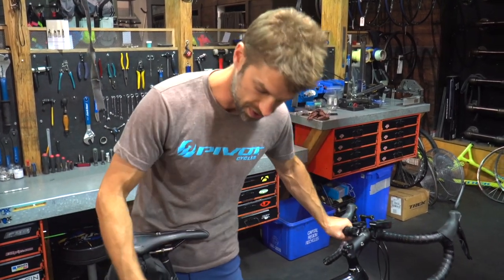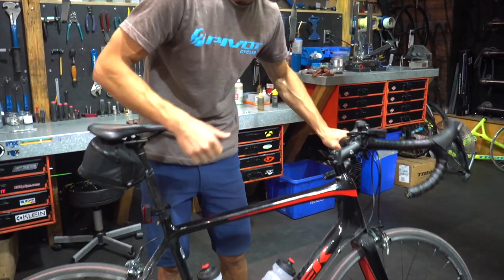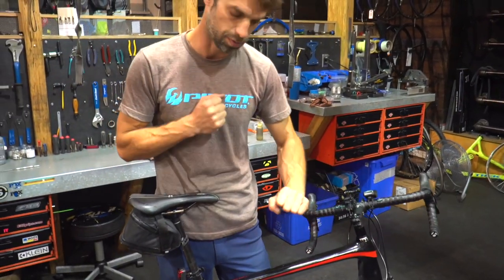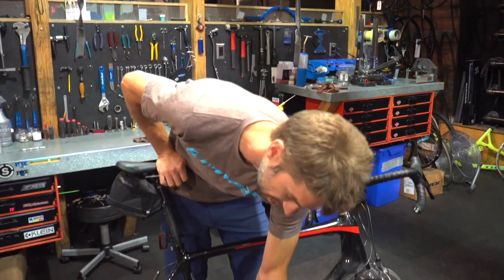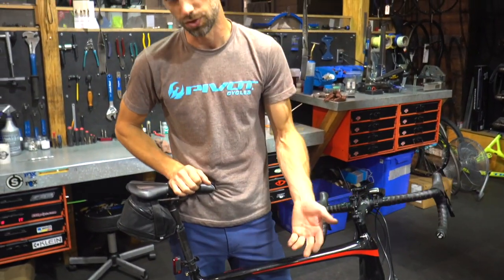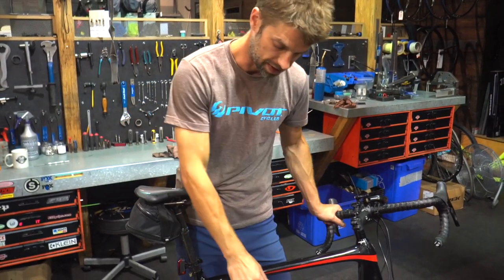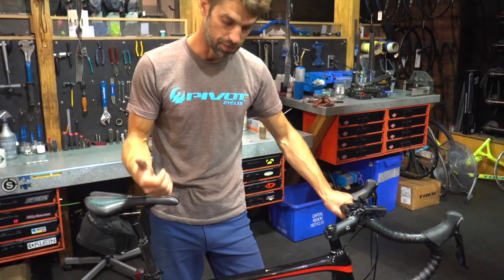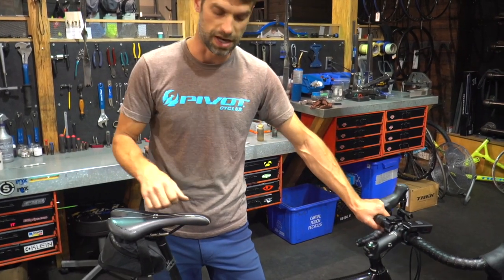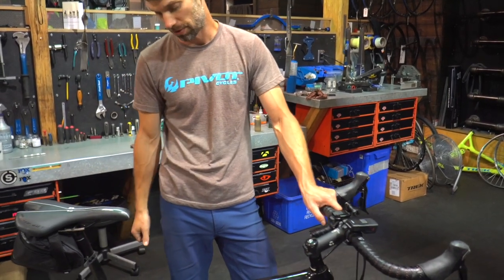It's okay to wash the bike — spraying a bit of cleaner on the drivetrain and on the frame is fine. What you want to avoid is really high pressure. Don't sit with your pressure washer blasting the bottom bracket area or the cassette area, as you'll get water behind the seals of the bearings and shorten their lifespan. It's better to get your cleaner on the bike and then use a nice brush and hose to rinse it off. We use a pressure washer here but that's only before we're about to tear a bike down and work on it thoroughly.